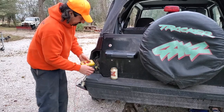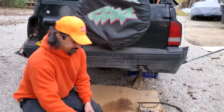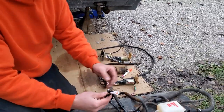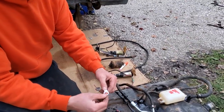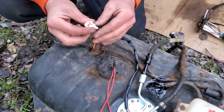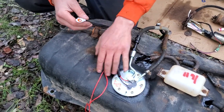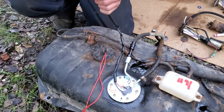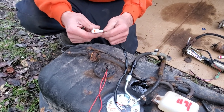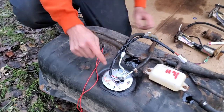This wire runs down and along behind the bumper, and there's going to be an outlet that comes out on top of your fuel pump. This connector dangles down right where all the rusty salt and mud is. We're going to unplug this, multimeter it, and if you're getting power here then you probably have a bad fuel pump — either the pump burnt out or you're getting power but the pump's burnt out. This connection also gets crusty, so it could be a bad connection. Sometimes you just have to clean it or snip the wires and reconnect them.